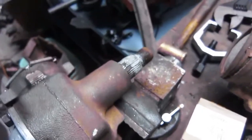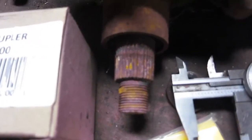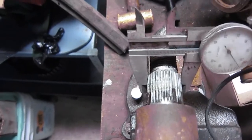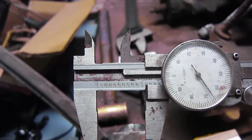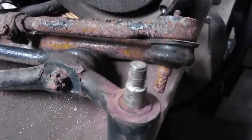There are three major things you need to have the right size of. On your input shaft you have what they call the three-quarter inch on the manual box — of course it's bigger on the power steering box. The second size you're going to watch for is your output shafts — bigger again on the power. And then the real headache I had was this tapered pin on the center shaft.